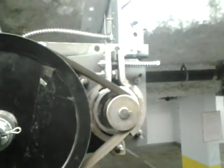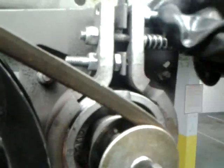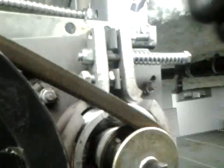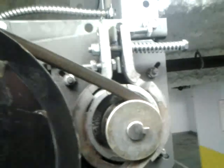So take your 7/16 out. So first thing you want to do, back off these so you can freely move back the brake. Okay, so there's lots of space, and you can start from scratch. That's what I like to do. Okay, so got lots of movement now. Solenoid can move all the way in easily.